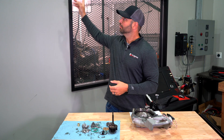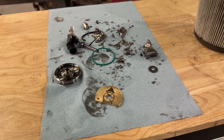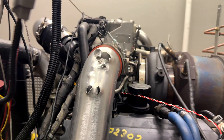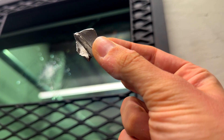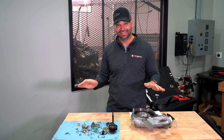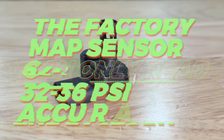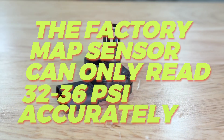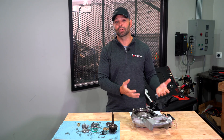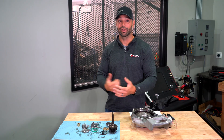In fact, this broken window behind me is exactly what happens. The compressor wheel literally explodes, comes out of the compressor discharge, and shrapnel goes everywhere. It'll happen on the first time out at full throttle on the truck. The best way to avoid this is simply not to command a boost number over and above what the factory map sensor can read. I have no idea how we as an institution, as a tuning industry, got into this position of commanding boost numbers the map sensor can't read. I don't do it, but I know it's out there.